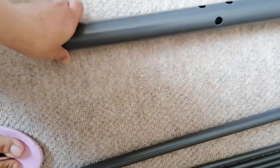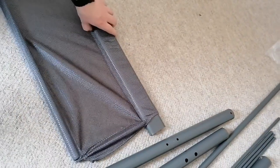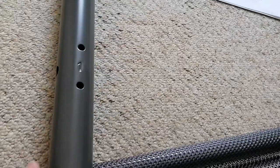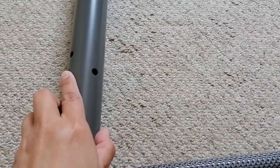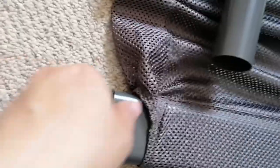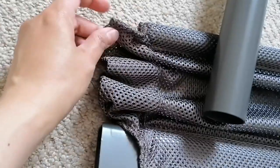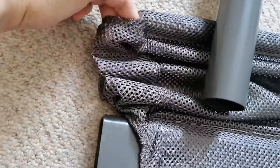From the long box we need the ones marked 1 and 3, and 2 and 4, and we're going to attach them to the one with the mesh. Number 1, for example, goes on this side — it has to be facing up, with the small hole facing the inside and the big hole facing outside. Now if you put it through this mesh, this is actually quite fiddly — just to warn you.